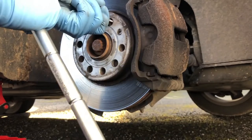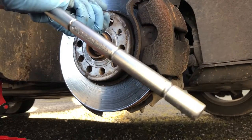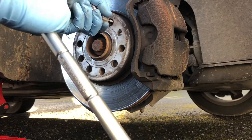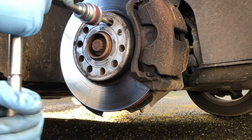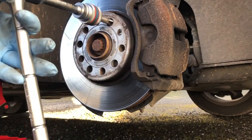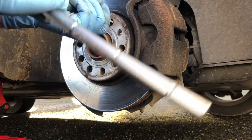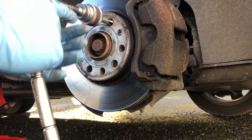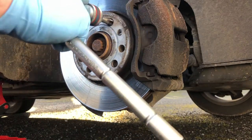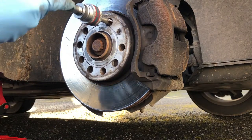You can feel it beginning to bite. Just when it gets stiff like that, rotate again in the opposite direction to clean out any burrs — you'll see them beginning to pop out. Then tighten up again and take it on until it gets tight, then change direction again to clean out any more burrs. Just keep repeating the process.